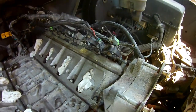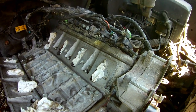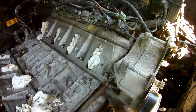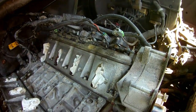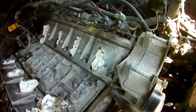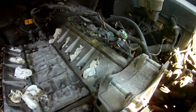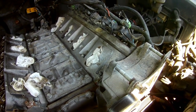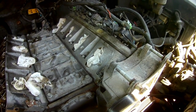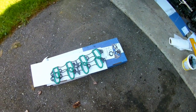I've cleaned these surfaces with a scraper very carefully — these heads are aluminum. I've got the material off. I'm going to spray a little more gasket remover on there and clean that up, then use a rag soaked with some brake cleaner just to wipe any residual oil or grease off of there so everything meets properly. Then we'll get the intake gaskets on and get that back together. Be careful when scraping — you don't want to scratch anything. Wipe down all these surfaces where the gaskets mate, then we'll get the manifold back on. That's the new gasket set.